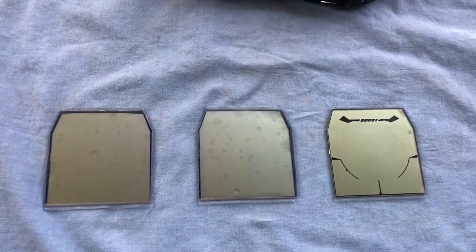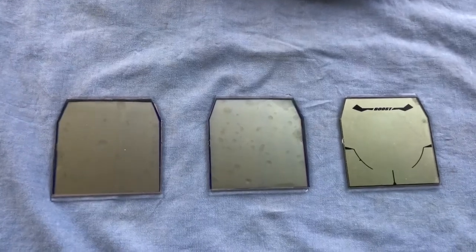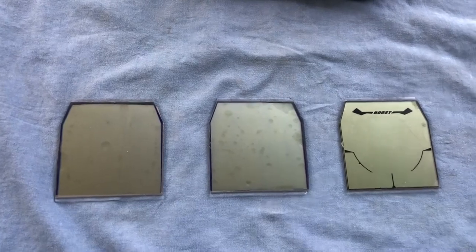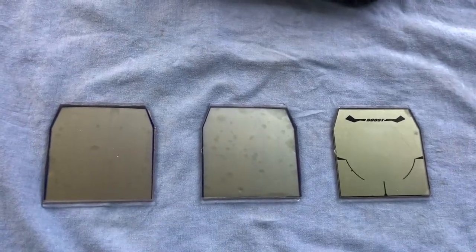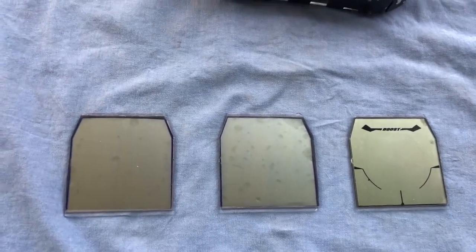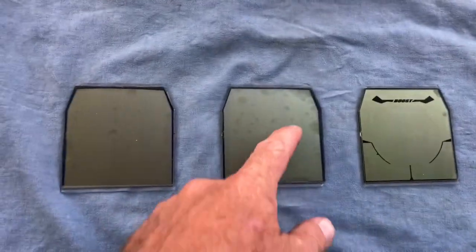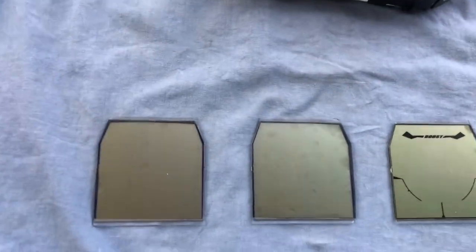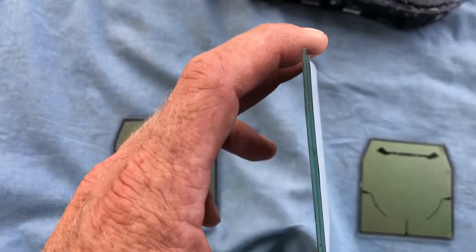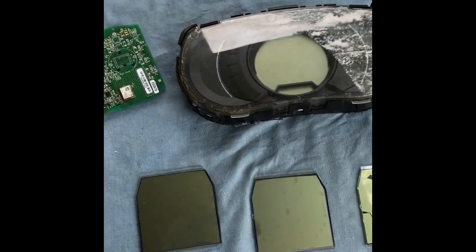I'm already too long in this business to know what works or not. Also when you don't know if your LCD screen is broken — always first, before you start, check your fuse by the battery: the display fuse. When that is broken and you put a new one in and it goes broken again, then you have an electrical problem. When your screen is broken with a crack in it and not working, forget it — because between the two glasses there are big pixels. That's how it works.